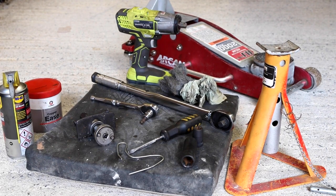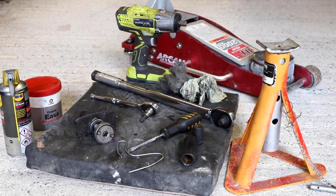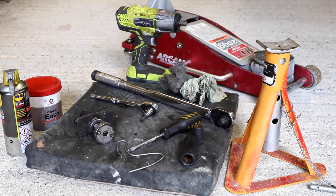The tools I used for this install were a flathead screwdriver, brake caliper winding back tool, a homemade caliper hanger, a 13mm impact socket, a 19mm impact socket, a 7mm hex bit and a 3/8 ratchet, an 8mm spanner and a torque wrench, some paper towel, steel wool, WD-40 fast-release penetrating fluid, copper grease, axle stands, impact wrench and of course a trolley jack.